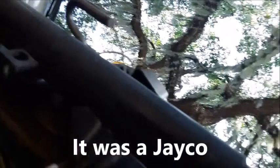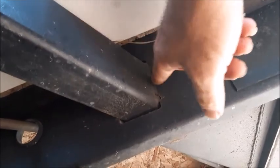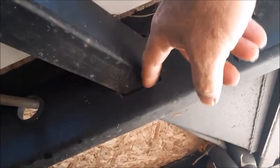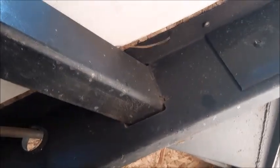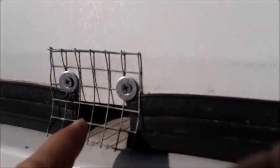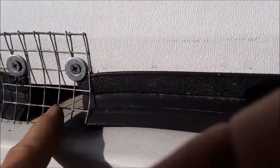This is part of the slide-out, but here's a half-inch gap right there that a mouse could start chewing on and make its way inside. On our last camper, which was built a little differently, the front tongue beam that came through the middle went through the front of the fiberglass, and there was a gap right around the front channel beam that a mouse went right through to the inside of the camper — that's when we had the biggest amount of damage. Even on the exposed outsides, here's a one-inch gap where the rubber comes across and meets — it's just a little too short. We attached a little piece of wire there to kind of make a block.